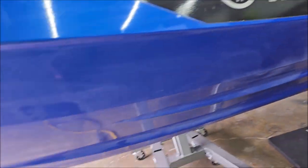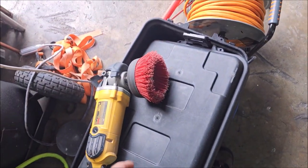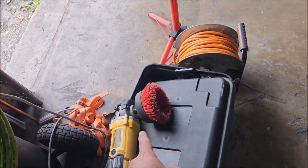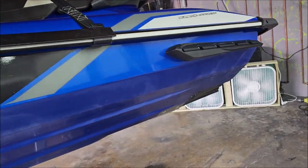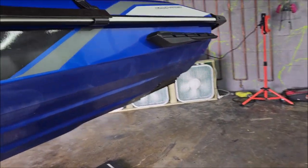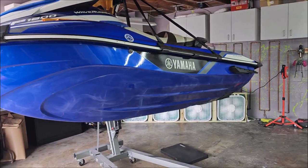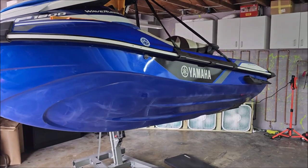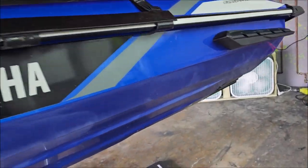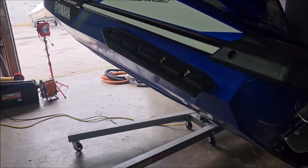I just sanded the bottom of this thing. I used a 120 grit around the edges and then I like to use my nylon wheel on the rotary to give me my good etch or key, if you will, for the liner to stick. There's some issues there, but none of these issues are real concerning to me, basically because we're going to be sealing it all in with a watertight seal, which is what the Versaliner is. So it should seal it and it should be absolutely fine. I have covered worse areas than that with liner, but if they were any worse than that, I would absolutely talk to the owner about filling them prior to covering them up.